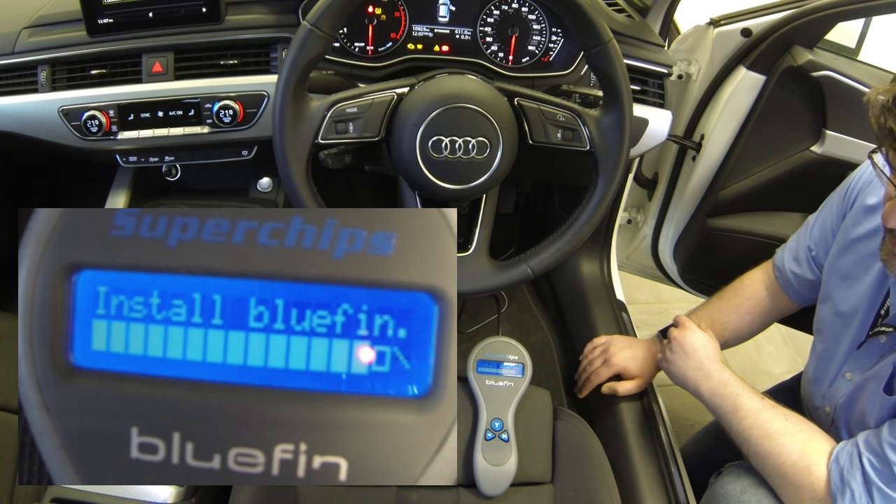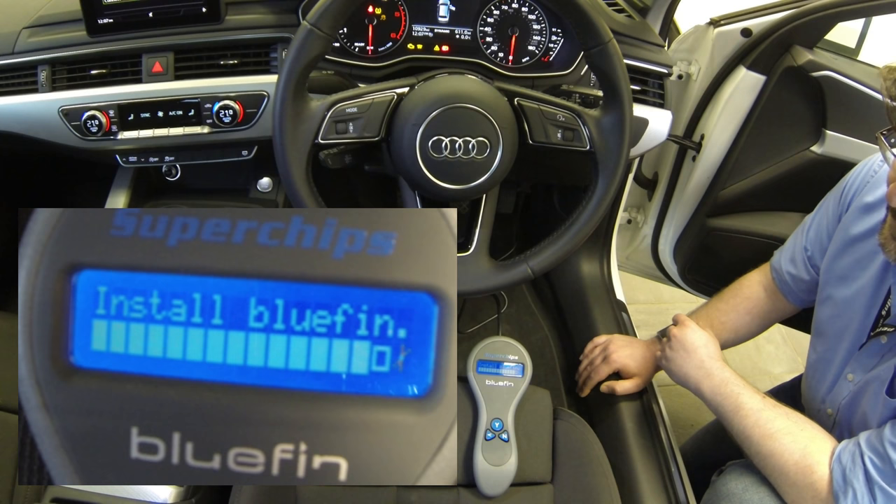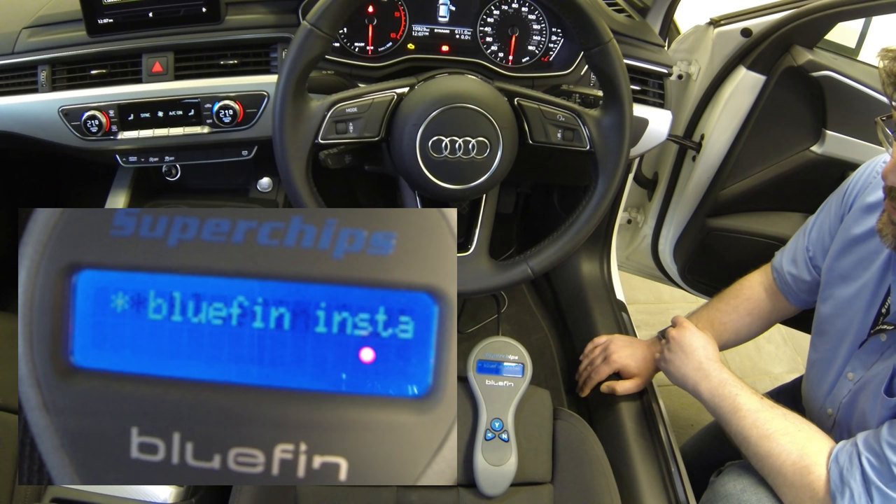So don't panic if that sort of thing happens on your car. Once you get to the end of the process, the little progress bar on the screen of the Bluefin will fill up. When it fills all the way to the end, the Bluefin will chunter through and clear out some of those errors that have been created by programming the car. So you'll hear the car clunk a few times, depending on the type of vehicle. Wipers sometimes go on some vehicles, that sort of thing — but it's nothing to worry about, all the errors do get cleaned out. Follow the prompts on the screen. But the Bluefin will tell you to do that, so you don't need to worry.